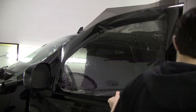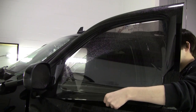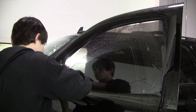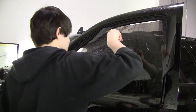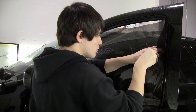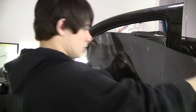Tack it to the window with a squeegee. Lift up the bottom edge and roll it down a little bit farther than you normally would on a window, because you want that top edge to pop out of the seal — that will make it a lot easier to cut it all the way across. Starting in the bottom left corner, working my way all the way around. Because this corner is a little more rounded, I can cut that out too. Just keep cutting down as far down that window as I can, then peel away the excess.